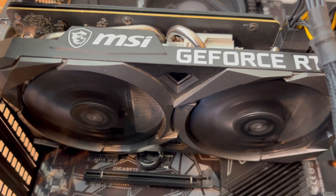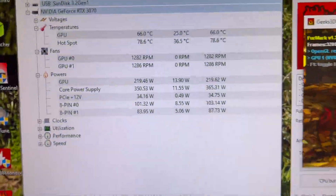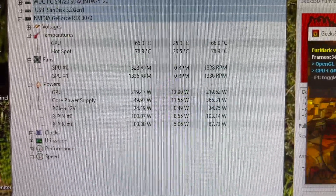As you can see, the fans are both spinning just fine and we got amazing temperatures. I am running a benchmark as we talk right now. We can see that the fans are actually running at the same RPM, which was not happening before because one of the fans was not able to run. This is just a general way to replace the fans. This helped out this GPU a lot and made it actually usable again — before it wasn't usable at all. It was making extremely loud noises when fully spinning and it actually couldn't cool the GPU properly. We dropped about 20 degrees on the hotspot and over 30 on the GPU core, and that's because the thermal paste was old and the fans were broken. So definitely we revived this GPU.